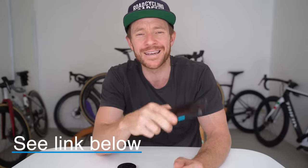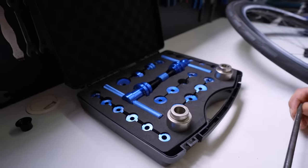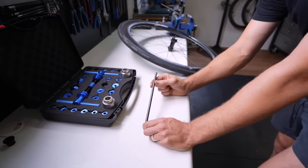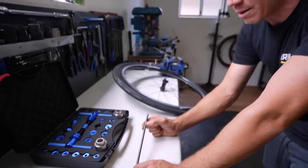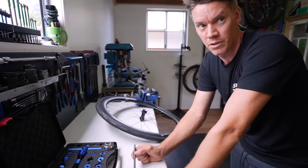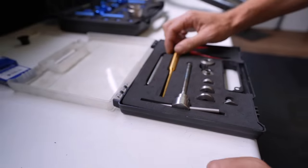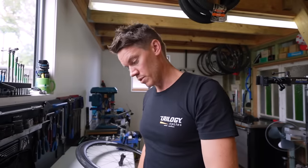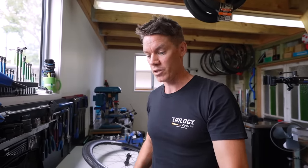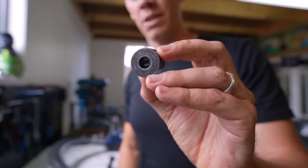Aaron uses a crow cam lifter — actually machined down from a V8 engine — to punch bearings out at an angle without damaging the hub. Once punched out, the bearing is damaged and not reused. There are various bearing punch kits; these do cost a lot. Many shops are now investing in proper tooling. If you're spending money on ceramic bearings, you need to press them in correctly — not with random drifts or sockets.